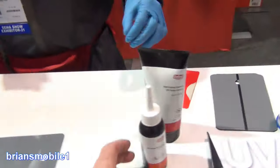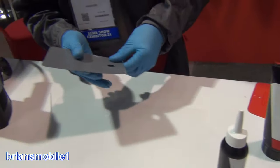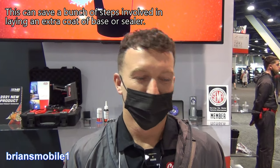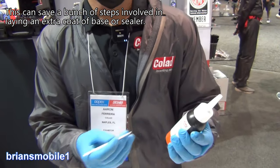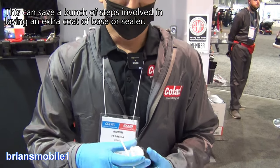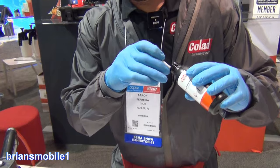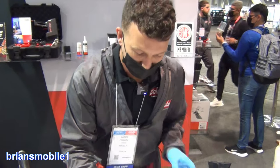And you have another product here — the UV putty transparent. What's the advantage of a transparent product? When you're painting the car and doing a blend into a door or fender, you find a chip near the headlight or door handle — you don't want to fill it with regular putty and worry about coverage. With this clear UV putty you just fill it in, wet sand it down, and you won't have to worry about putting two or three coats over a spot. You can just put a dusting, or possibly nothing at all.